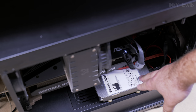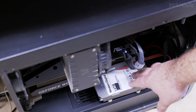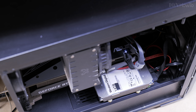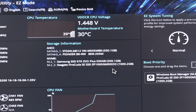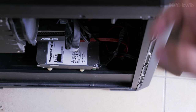I changed the SATA cable and reseated the SATA power cable — it did the same thing. The drive is not spinning up; it stays powered off and it's like it's not working at all. It's not recognized in Windows, not recognized at all, even in the BIOS. It looks like the drive is not working, but it's not a dead drive.